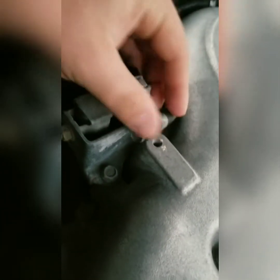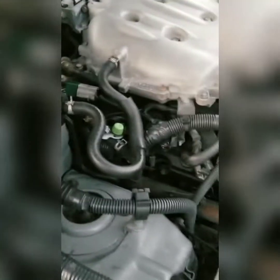That is the purge control valve right there that it's reading the code for. When I did the motor swap on the vehicle, I kind of broke the fitting back in there. It might be hard to see. It's back down there somewhere, but it's just a vacuum line that goes back down in there, but I'm just lazy. But today, if it's cheap enough, I'm going to go ahead and do it. So I'm going to start tearing stuff apart, and I'll see you in a few.